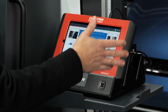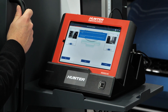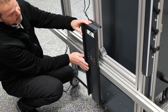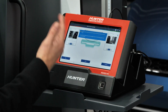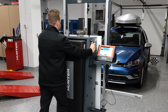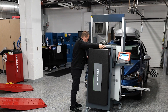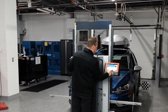Now you can see the ADAS Link and cameras are looking for the actual boards to make sure they're in the reference position. It's asking us to push the DAS 3000 all the way to the bumper — the contact plate in the front must touch the bumper. Make sure you take a look at your cameras to make sure you can fully see the reference boards and that they're not distorted or have any debris on them. Everything looks good, so I'm going to push this all the way to the bumper now — nice and slow, centering it with the emblem. I'm all the way in position now and can press continue.